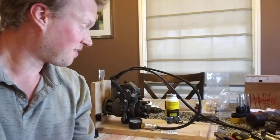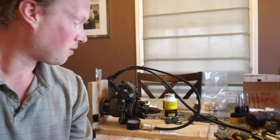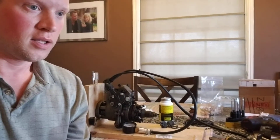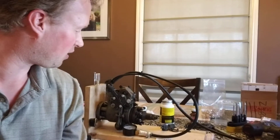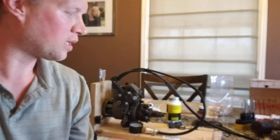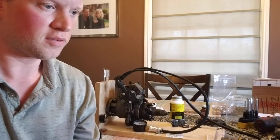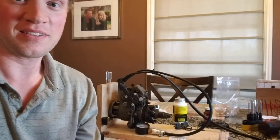I've got some good news. As of today, I finally have a fully functioning brand new VRV for the C6 IDI. I just did some more calibrating and got the vacuum pressures to spec, and it's really exciting. It took a little bit because my springs are slightly off, which makes the vacuum pressure really hard to control, and also the part where the rod mates with the top of the cap has to be perfectly smooth — I'm going to have to figure out a solution for that for mass production. But this is awesome — it's working.